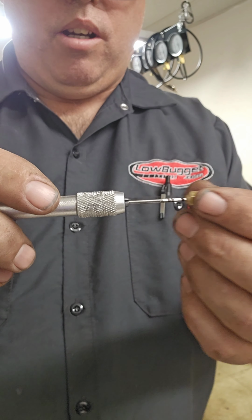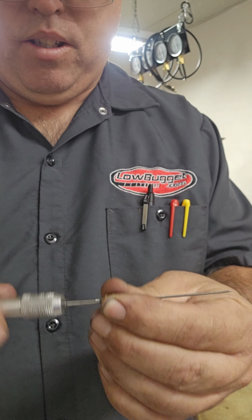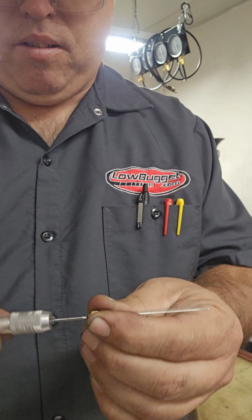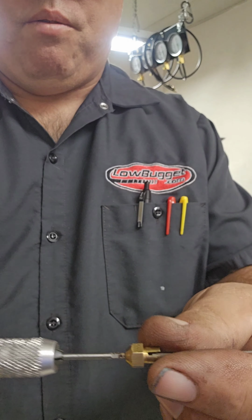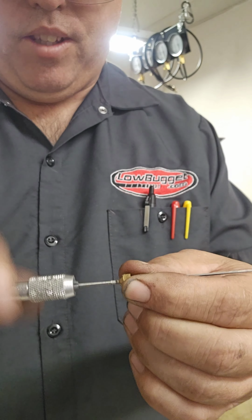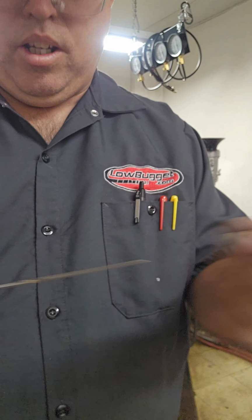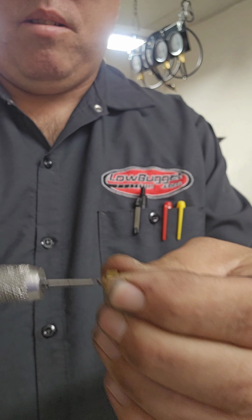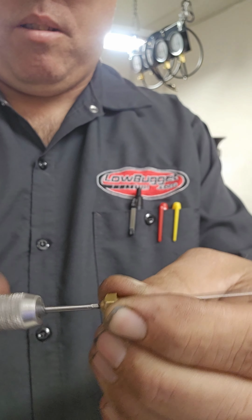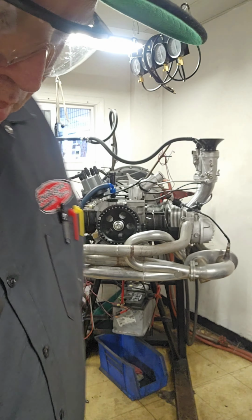Let's put another one on here, and you'll see it's just falling short. There you go. This guy, same thing, just falling short of it, because that's where the last time I jetted it. And that's a half right there, so that gives you an idea. It makes that big of a difference.